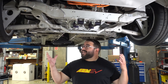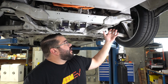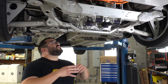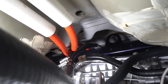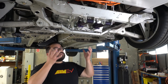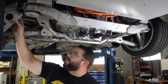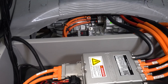The main part of adapting the independent rear suspension was to get the Tesla subframe into the car. We had some really nice mounts made up that attach to the stock mounting points of the Tesla subframe. The Illuminator mounts in a unique fashion — at the very top across the arches of the subframe is a big bar with some bushings on the end that we fabricated. We've got torque bars going to the rear cross member, and we're running QA1 coilovers with custom brackets mounting off the outer hub or knuckle up to the car's stock shock mount.